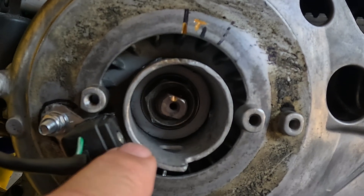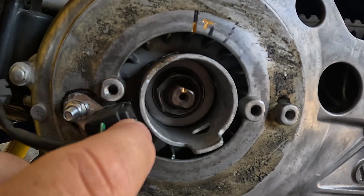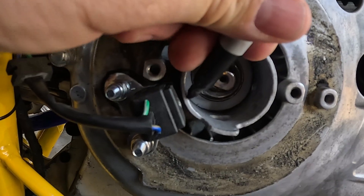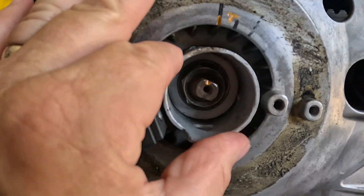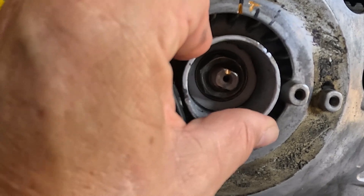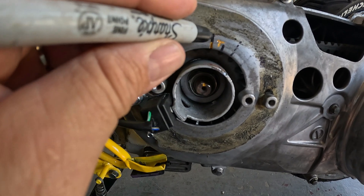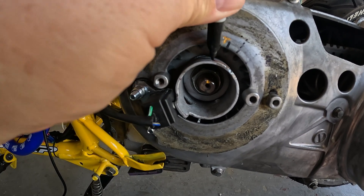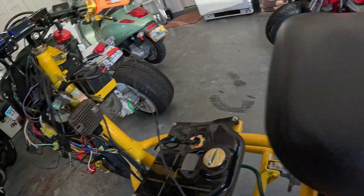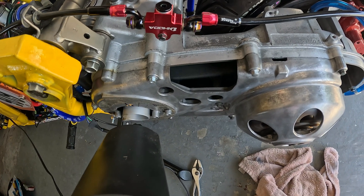So I've got to rotate this even more backwards and make a new top dead center mark to see how far advanced it is. I marked the crankshaft top dead center so I can keep it lined up — I have a reference. With this at top dead center, I want this function to happen later — retard it more, it was way too advanced. We were about 70 degrees too far, so I went quite a bit back. Because I moved the reluctor, top dead center on the reluctor is now right here, a whole new line — and that's the line we're concerned with now, the one we want to be 10 degrees before top dead center. Yeah, see how much better it started? Much nicer. It's about 20 degrees before top dead center, so we can go a little bit more.